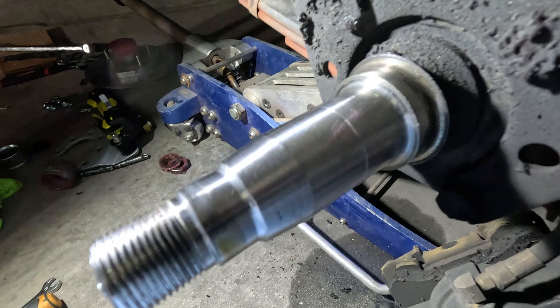We're looking for any kind of serious scarring or scrapes. Let's get you guys moved in closer so you can look at the spindle with us. You can see all that wheel grease slumped all over the brake caliper bracket, but looking at this spindle we can see there's really not anything for us to be concerned about. Right here is where that seal rides — a good smooth surface — and this is going to be where the outer bearing rides. Everything looks good.